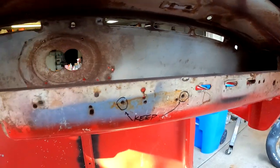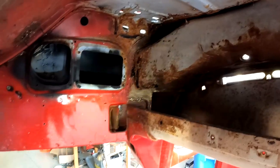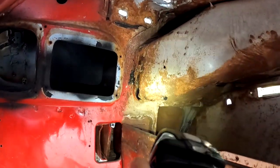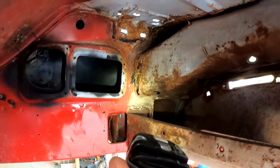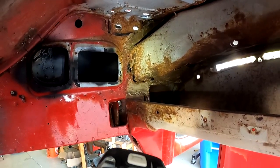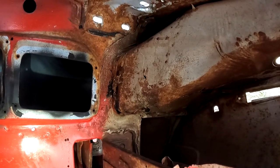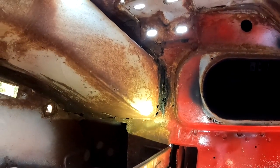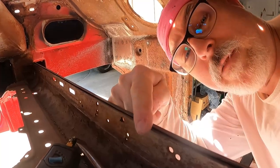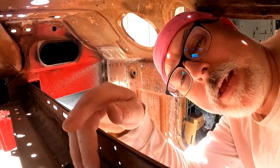I need to fill all those holes. These other ones are used for the hinges, for the glove box, and the steering column. So not only do I have to fix these few holes, but right up there on both sides in the corner — there's the vent hole right there — that's where the air comes down into the air dome, and it is rotted out along the seams. So I need to take off that old seam sealer and fill all these rust holes. I don't think I'm going to be super anal about this because it's going to get covered with seam sealer, no one's ever going to see it, and it is tiny in here — I don't want to weld in here. So I'm going to get this done as simple as possible. I'm going to tackle the hole fills first because it's probably the easiest thing to do. Before I fill any holes I need to take off the high sides from the drills and get rid of those so I can put my little copper paddle back here to make filling the holes easier.